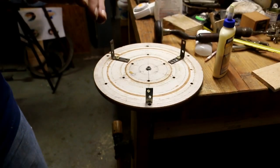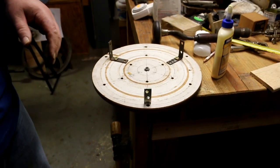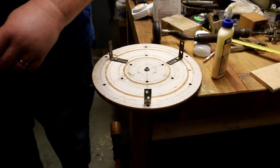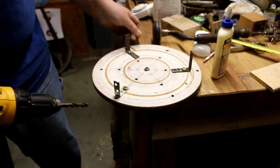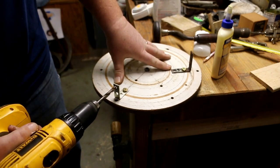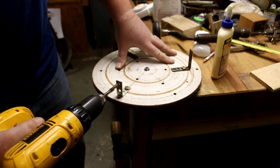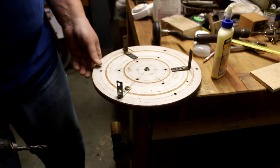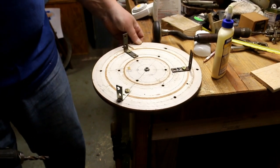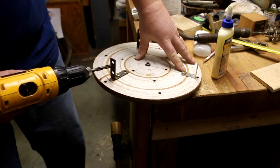The first time I tried cleaning out a gas tank, it was the tank out of my tractor, and it was really rusty on the inside. So I strapped it to the front of my cement mixer and filled it with stones and some vinegar and started cranking it around. I left it run for a couple of hours, and it cleaned most of the rust out of it, but unfortunately the little stones got caught in the baffles. It still rattles.